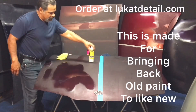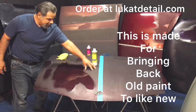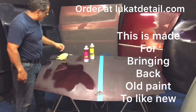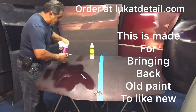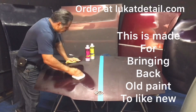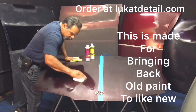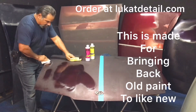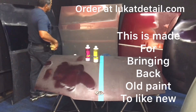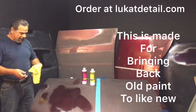This is not the finish. This is designed to take the oxidation off — it's called a color and gloss restore polish because underneath there's a lot of color and gloss, and you can see it right there. Now I'm going to use a sealer wax afterwards. This is not regular wax — regular wax is just for shine, this is for protection. Now I'm doing circles. I'm using a terry cloth towel — a different one from the cleaner. For the cleaner I use this one; for the wax I use this one. Work it into the paint — a little bit of this stuff goes a long way. Use the cleaner to remove the buildup, the contamination, the oxidation. It'll take off all the stuff, and look what's there — you just have to clean it to get the color to come back.